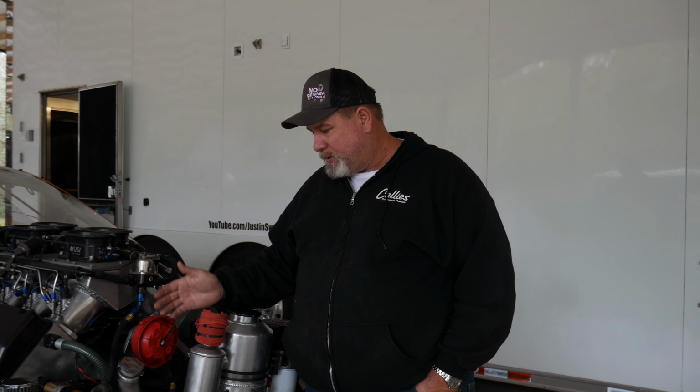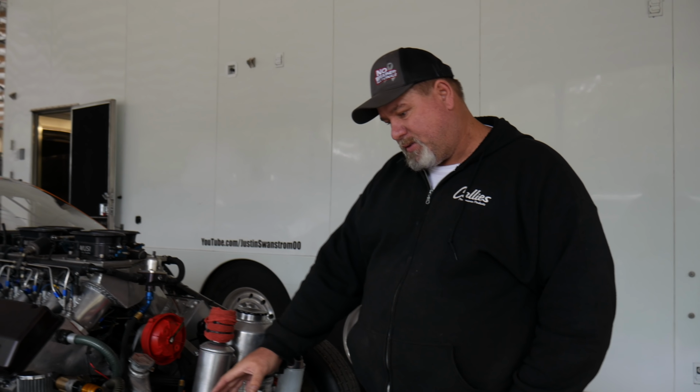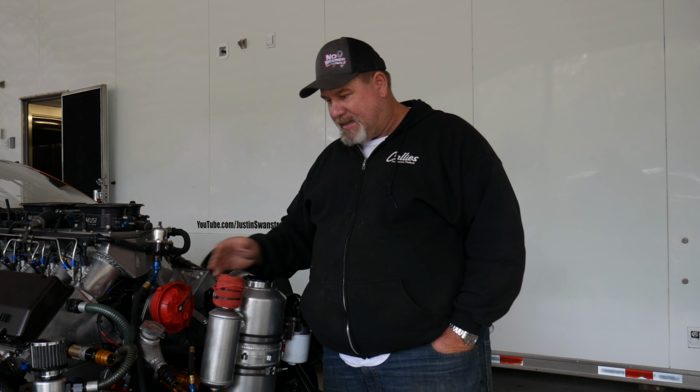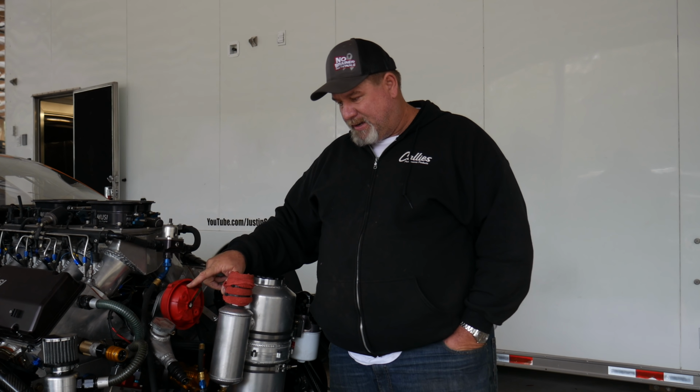So when these motors are put together, you got a crank trigger phase. You set the crank trigger at whatever you set them at. Some guys set them differently. We got a cam sensor phase that we set in. My stuff might be a little bit different than the next engine guy's. And then you got a rotor phase that you got to phase in.